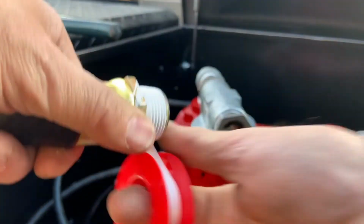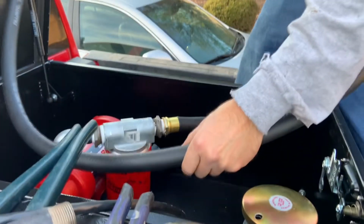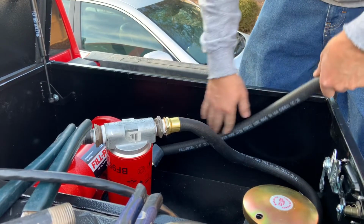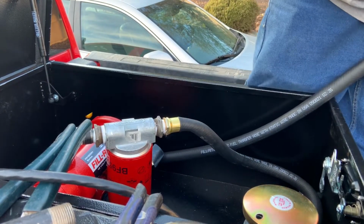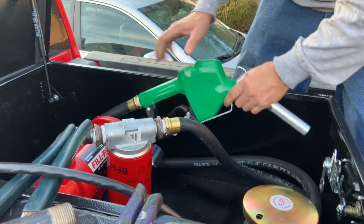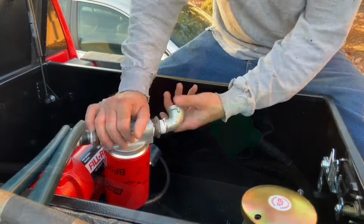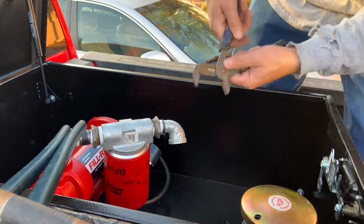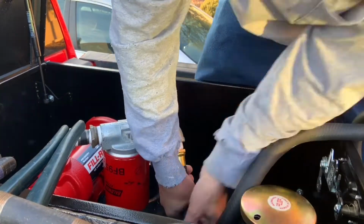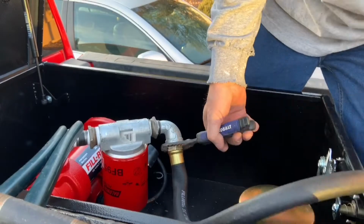Then I went ahead and pipe taped my hose assembly and put that on as well. Now most likely with these setups, your first point of failure is going to be your hose, and 99% of the time it's going to be right after your pump or fuel filter housing because of the weight on the hose and the bend it produces. This holds especially true when your pump and hose is exposed to the sun, not covered up in a toolbox. So what I did to correct this problem, even though mine is in a toolbox, is I put an extra 90-degree elbow.